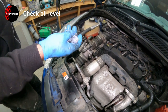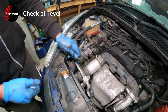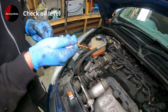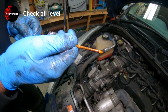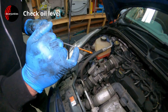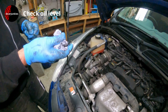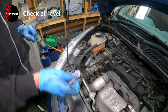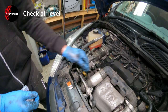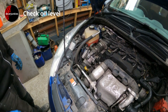I've pulled the dipstick out and given that a clean off — we'll just see where we're at with the level. The recommended capacity is just under four litres — I think it was 3.8. I've put 3.6–3.7 litres in there and we're right up to the maximum now. So, just goes to show — start with a slightly smaller quantity, dip it, and keep checking. If it's slightly too low, just top it up with little dribs and drabs. It's a lot easier to do that than getting back underneath and draining out any surplus oil.